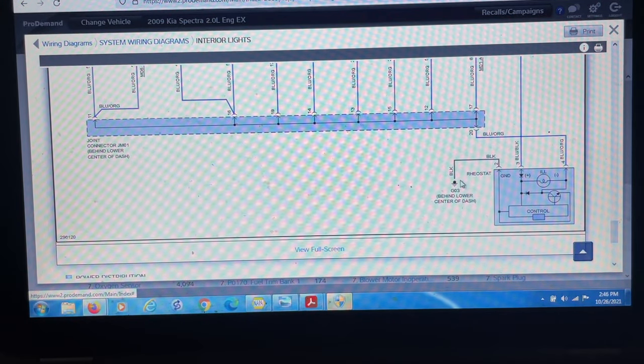So let's verify real quick — go look at our power window switch and make sure it's illuminated when we turn the headlight switch to the on position. If that's working, then let's verify that the blue and black connector 7 has voltage, and then verify we have a ground. So we're inside the vehicle. We're going to turn this to the on position — basically like turning on our headlights. It's working! So if we look right here, that feeds the power window switch, which feeds those bulbs. Now what we need to do is find connector 7, blue and black, with the cluster still out.